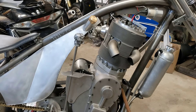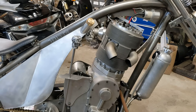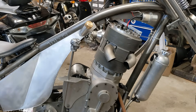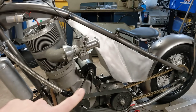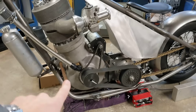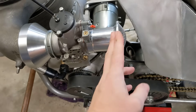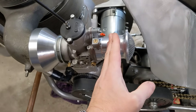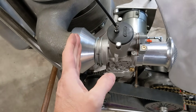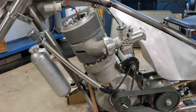Sitting back on the stool of contemplation — I've been thinking more about manifolds, because as someone quite rightly pointed out, the carburettor is quite close to my knee. When I sit on the seat, some of the comfortable foot peg positions would put my knee right under this carburettor bellmouth. I've ordered a new bellmouth that's half the distance, which will help, and I could remake this part so instead of having a cone there's a more abrupt change between the diameters. Someone also suggested turning the manifold around so the carb faces forward.